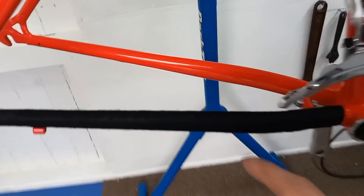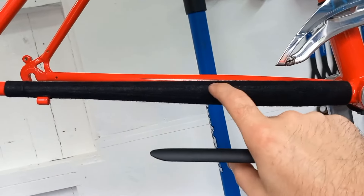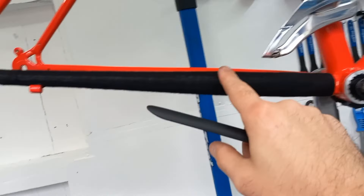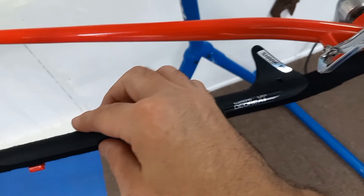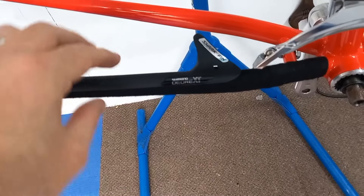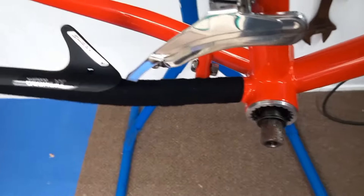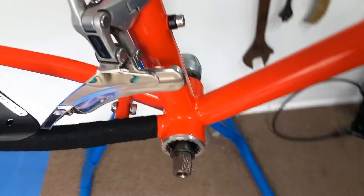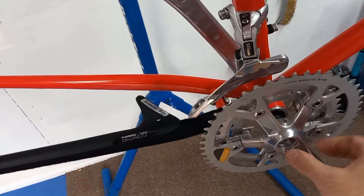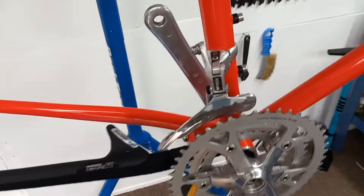What I've done is a full wrap down the drive-side chain stay just to protect everything from oil and all the crap that gets in and around there. We've got a new old-stock shark fin that's going to go on — I'm not going to strap that on yet because I want to set it when the wheel's in. I've just put a little bit of copper slip on the axle and now we'll put the crank on. That is starting to come together — let's get this all bolted up.